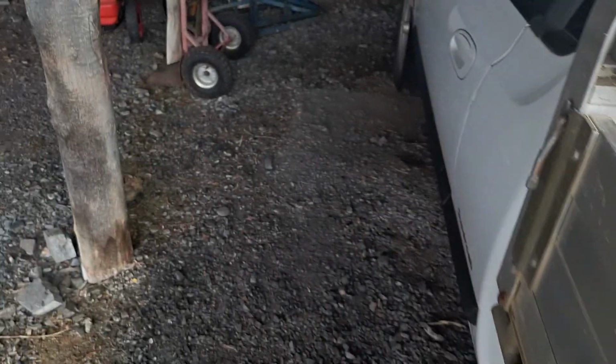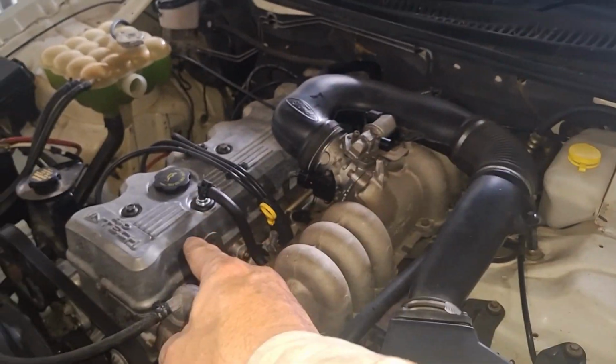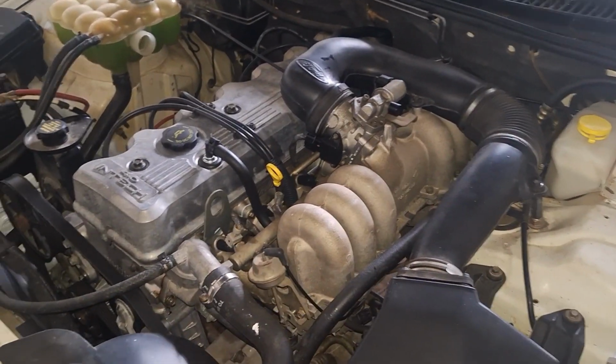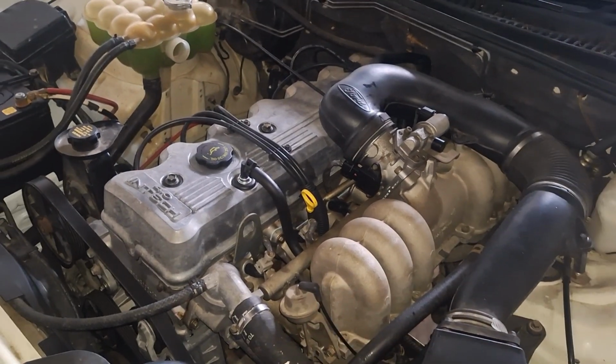So once I sorted that out, it sounded like a diesel because it had so much build-up crud inside it from me starting and trying to figure out what's going on. The PCV valve was shot too, believe it or not. It just rattled, it wouldn't seal. You can buy those new on eBay from Ford. I think they cost about $12–13 including postage.